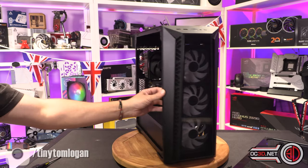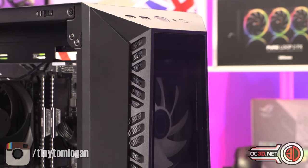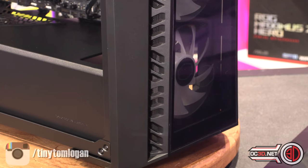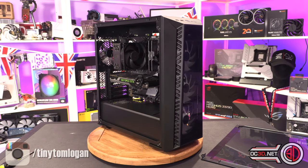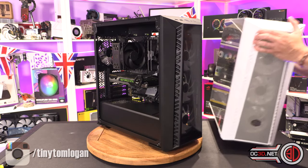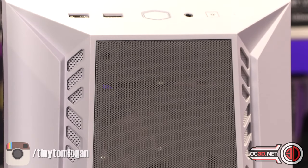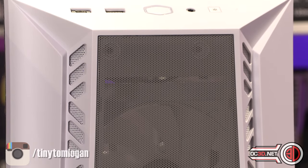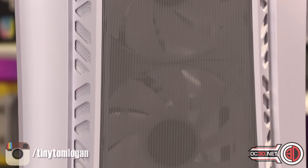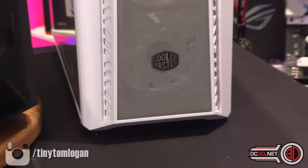Round the front — tempered glass here. To be very clear: because you have tempered glass on the front, those little vents down the side are the only ventilation into the front of the case. It's pretty much blocked up by that tempered glass. With the mesh version, you get the little vents down the side plus a big mesh panel across the front. The white model has a grey mesh panel, which doesn't match the white side vents — I'd prefer they pick one colour and stick with it.